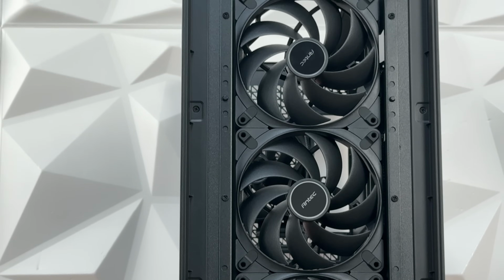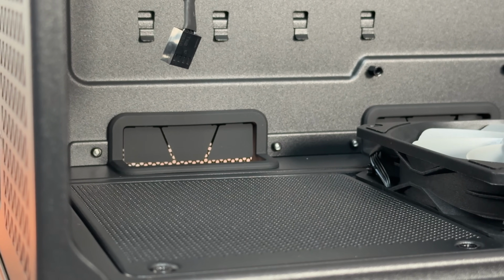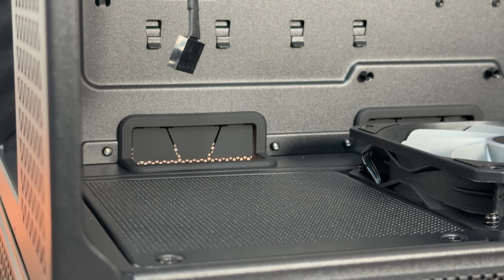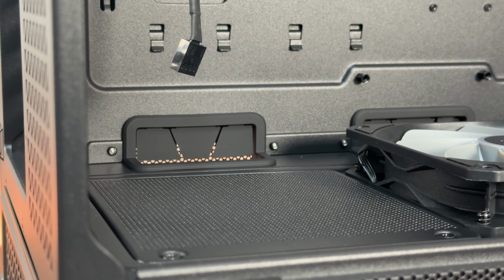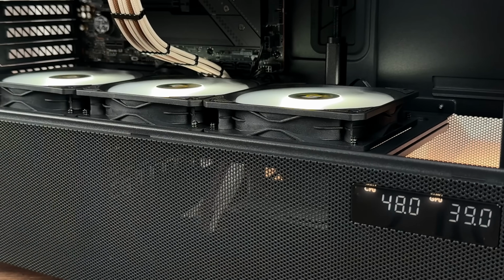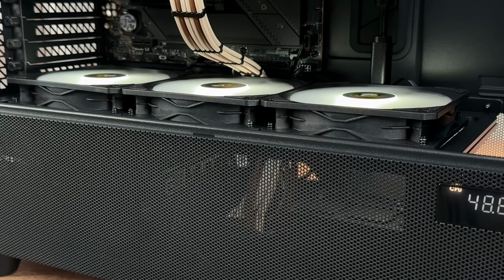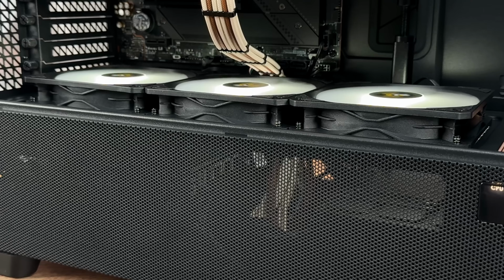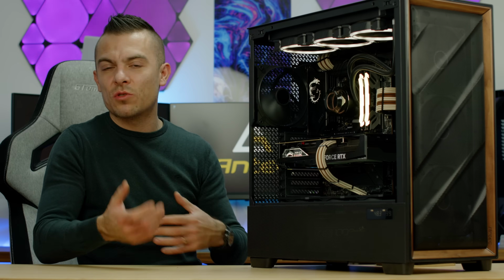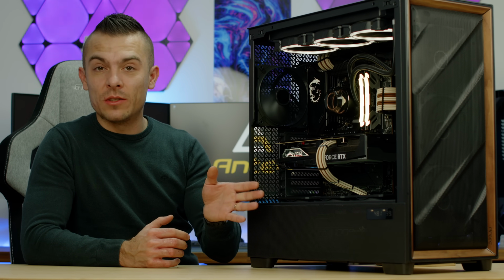And then we go with the power supply shroud. Now, the power supply shroud, you can notice here I have 3 fans now. But the original stock version comes with 2 fans that are dedicated to create additional intake for the GPU and eventually create an intake for the side, because not everything goes directly to the GPU. Regardless of that, you can remove those fans if you don't want to. You can place 3 covers and place hard drives on it. That's something additional that you haven't had before. So you can reorganize the storage and all the other stuff. But if you actually really want to place 3 fans, you can do that as well.